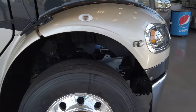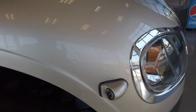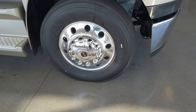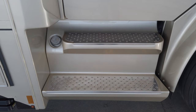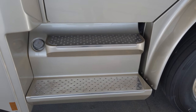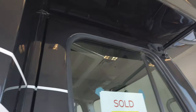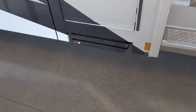Looking at the front fender, you can see a side view camera. You might also see the diamond shield across the front, which helps with nicks from road debris, rocks, or anything that may chip up off the road. You've got commercial grade Bridgestone tires and aluminum wheels. Your steps here — on the Verona product it is a straddled diesel fuel tank, so you've got a 50-gallon tank on the passenger side and a 50-gallon tank on the driver's side. Big truck mirrors and a heavy duty automatic step that comes out.